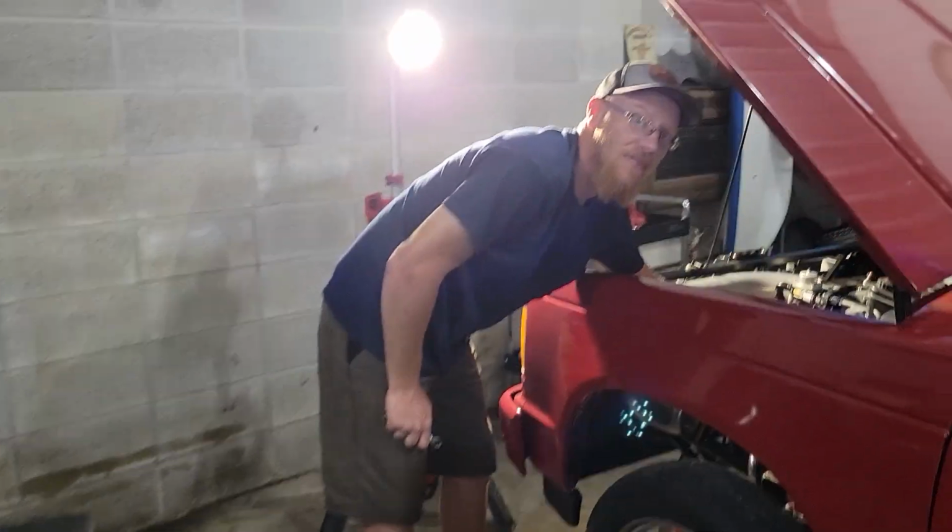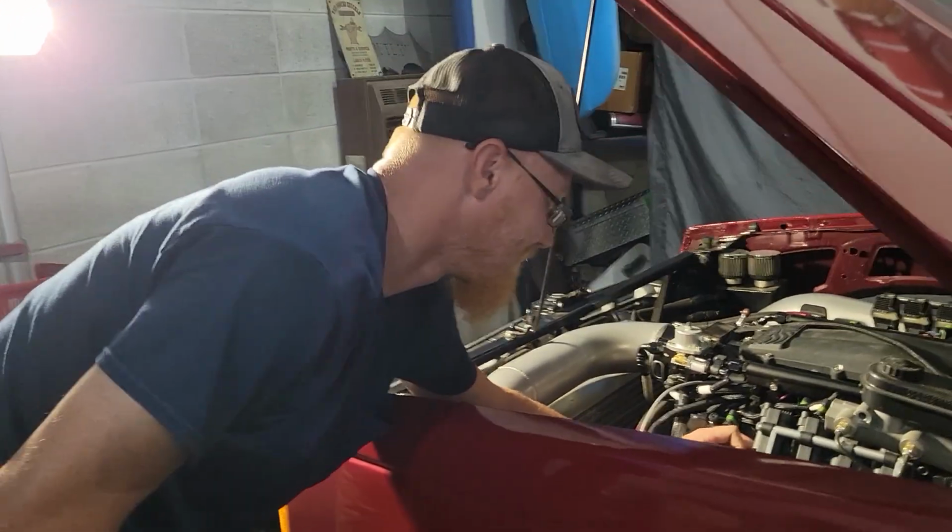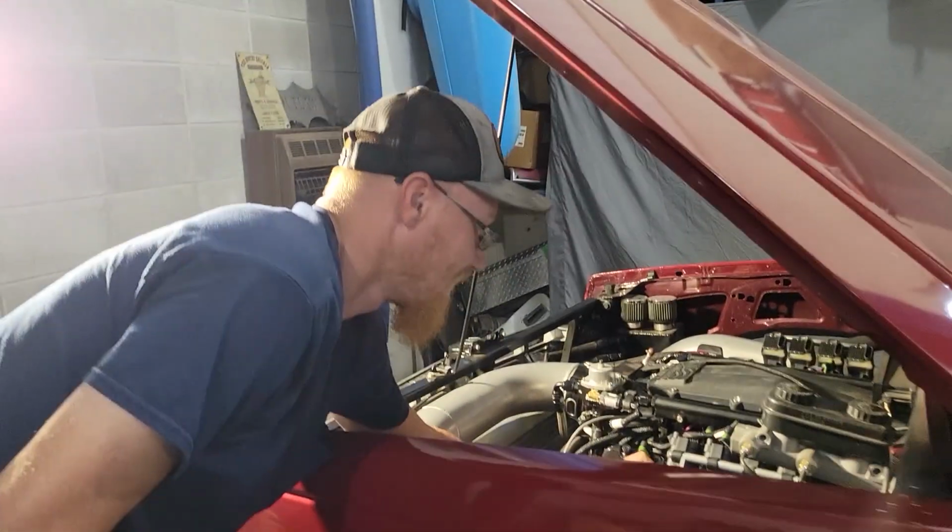All right, well, we didn't get a race yesterday, and that worked out for Dylan because his truck was broken. We almost stayed up all night if we would have had parts to fix it, and I guess I'm glad we didn't because it would have been all for naught. So the problem we had is it was pouring some antifreeze out of the exhaust, which is hiding back here. And it's not antifreeze, I guess it was straight up water. It hydrolocked when you tried to fire it up in the trailer, right? Yep. And then it worked through it, and you pulled the plug, and you saw water in the cylinder on top of the piston.